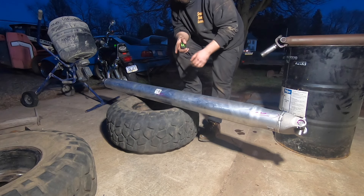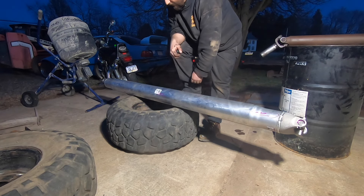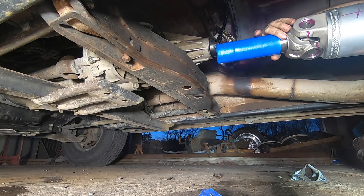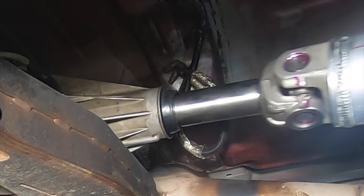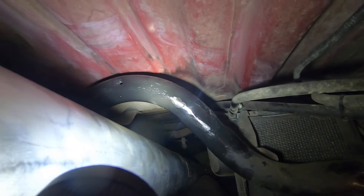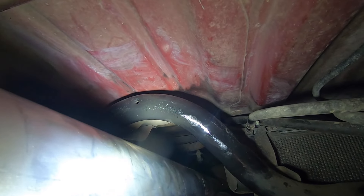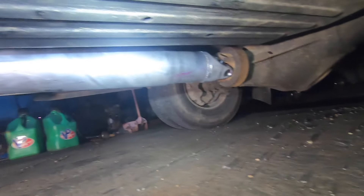It's about 84 and 7/8 inches from center of U-joint to center of U-joint — that's the length of this shaft for the part number I gave you. Keep the protector on until you're ready so you don't bang it around. Right in there. So a little clearance testing — at ride height, it can go way up before we hit anything, like six inches of up travel. This truck doesn't have that much before it bottoms out, so we're safe on all frame clearances, exhaust clearance, and fuel tank clearance.